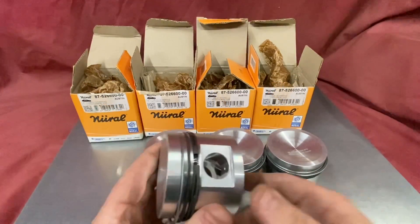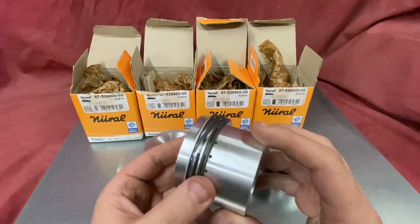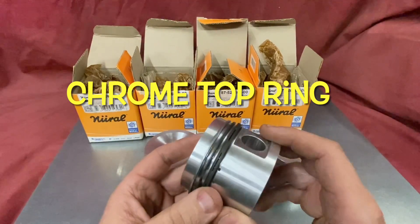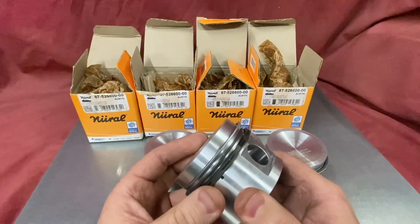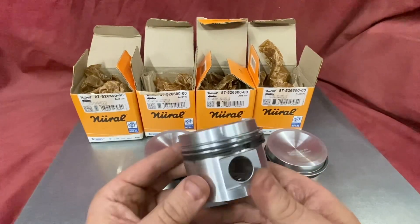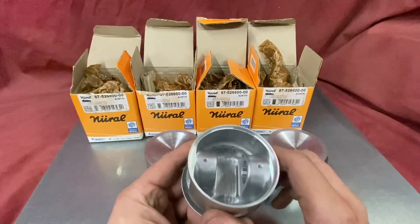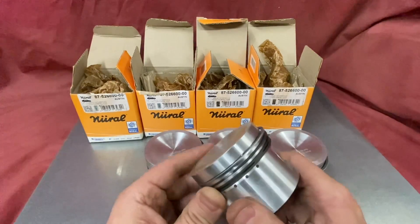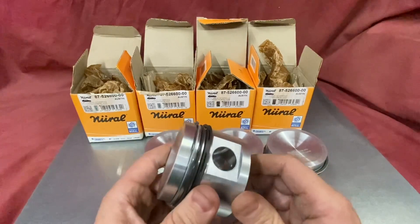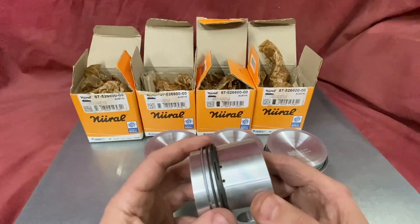Pistons are unpacked. These are a nice quality piston — they come with the usual chrome rings and have got the later one-piece type oil ring, which I'm not a big fan of. I can't really moan about them; that's just the change in production and saving costs over time. These pistons feature drilled oil return slots so they're quite strong, and this particular design has been around for years so they work very well. For this road-based 1380 engine application, these pistons are ideal.